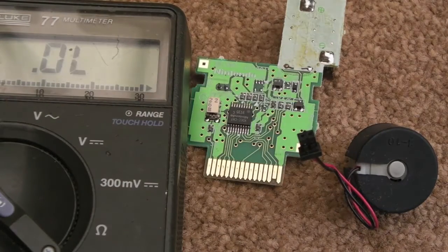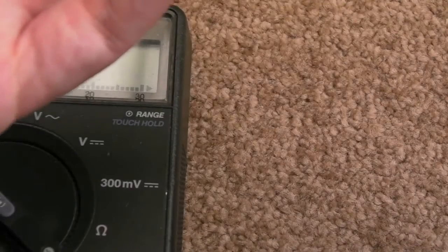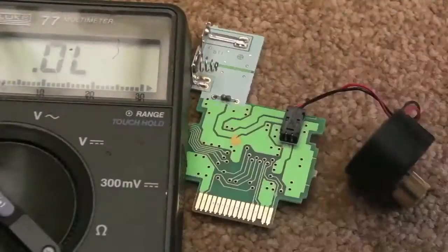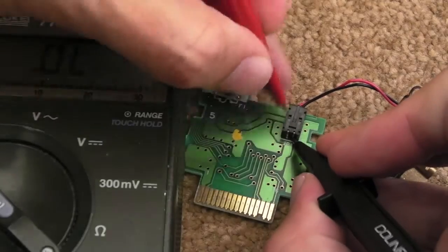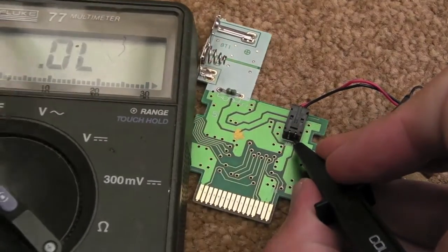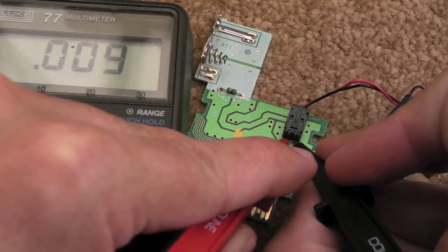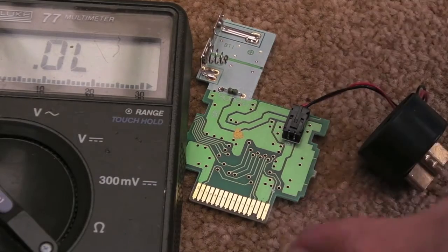In a motor, it's a coil that goes around the whole thing from plus to negative. If I reconnect the motor and measure across those two points, it should be something like 9 ohms or so. There you go — that's the reading we were getting from the diode. So we know the motor coil is okay, it's not faulty.